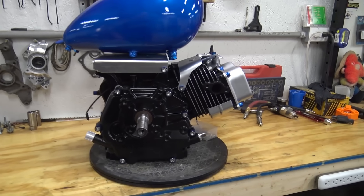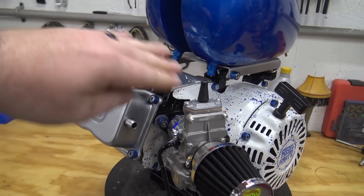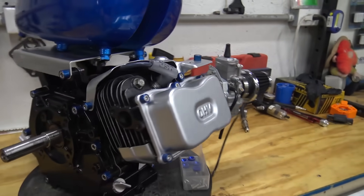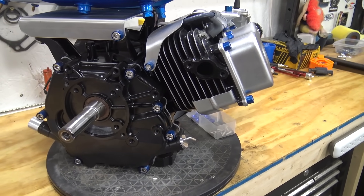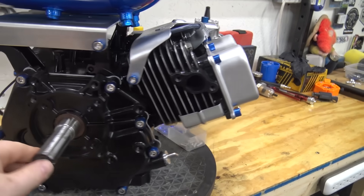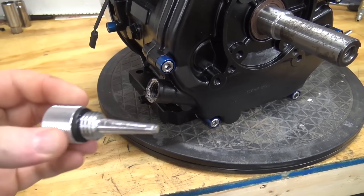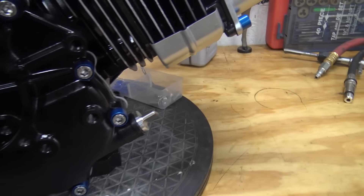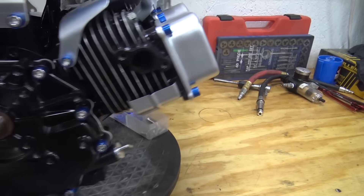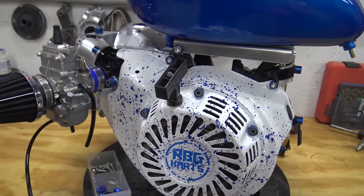She's all put together. We painted the valve cover and the air duct to make it look nice. We'll heat the engine in stages to cure the paint — start it up, let it run a few minutes, shut it off, let it cool completely, then repeat three or four times until we reach full running temperature. I always put in these billet oil dipsticks — they have a neodymium magnet in the end. We went with a Go Power Sports 26mm flat-slide Mikuni carburetor, and with the head ported she should be pretty mean. We cleaned the side cover up and she looks great.